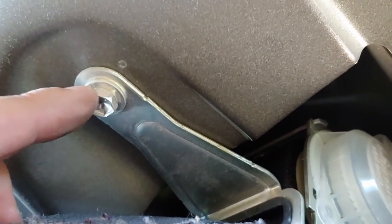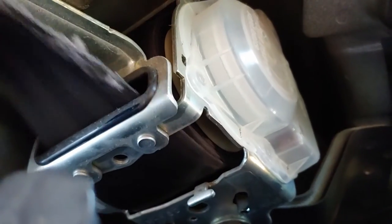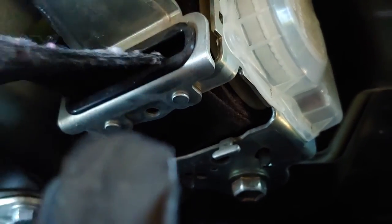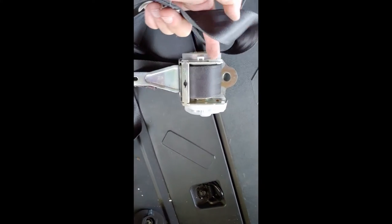Now that that's off, we just have the retractor itself. If you pull this black panel out a bit you can get to the bolts — this one up top is a 10mm and down there is a 14mm. I did notice the new retractors were locking when I would go to pull the belt out. It's because it has to be at this angle and in this position for you to pull the seatbelt out — otherwise it locks in place. So don't panic if yours aren't coming out when they're new in the box; they're not supposed to. Just got the old one out with those two bolts — the 14 and the 10.